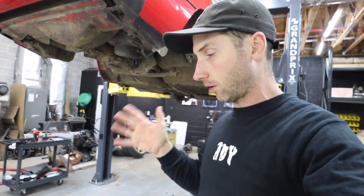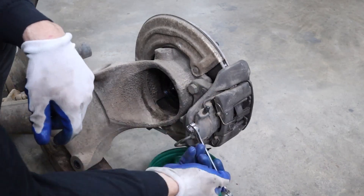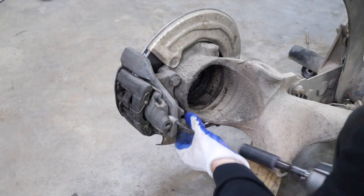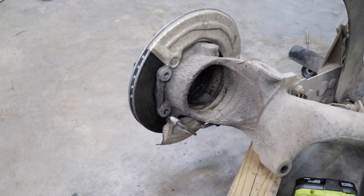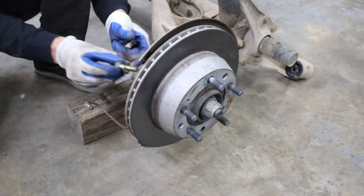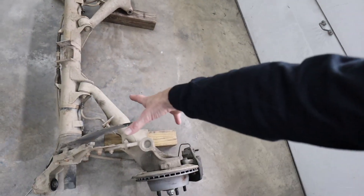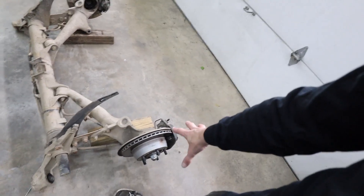What we're going to do now is get everything taken apart, pull the torsion bars out, then get the steel arms and spring plates on, and get it right back in the car. It'll be a handful, but luckily from there all I have to do once everything's back in the car is take the trailing arms off individually to do all the maintenance.